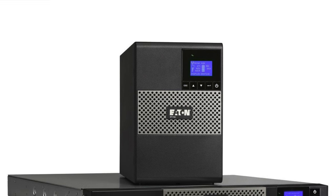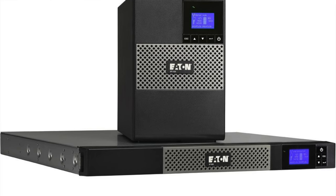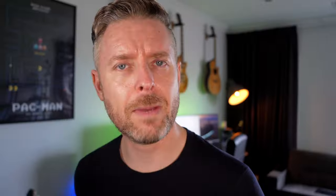If you want to power the whole thing, you may want to consider looking at a UPS. You can also get some PDUs — power distribution units. At work I had lots of UPSs to make sure all of the equipment was always powered on. At home I never thought about it, but one day I decided to get myself a UPS. I've now got it plugged up and my entire home lab can have about 45 minutes' worth of power on my UPS.